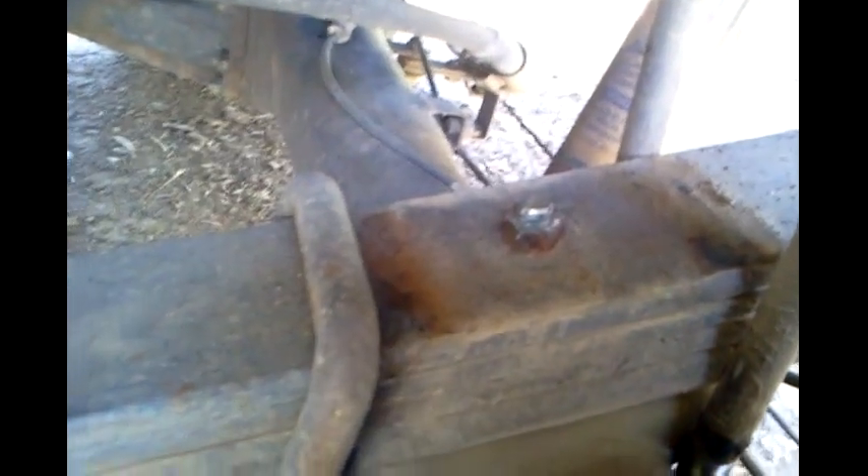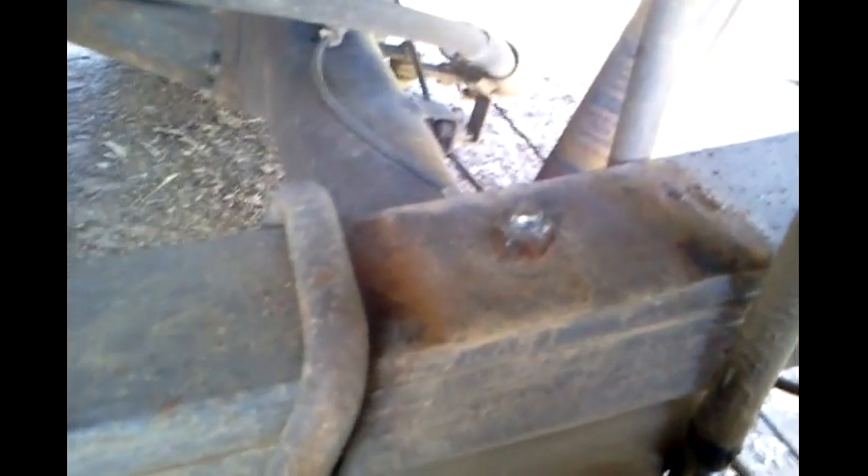I'm doing the 991 Hellwig spring installation. I've taken my U-bolts off — one of them completely off — and all I need to do is just slide it underneath there and put it all back together. I don't even have to take the thing off, really. I just slide it underneath.